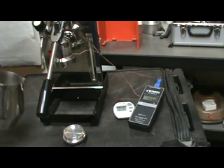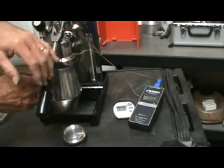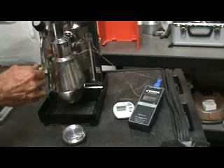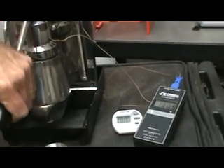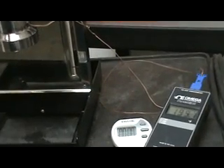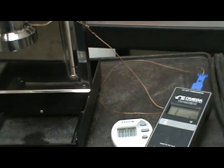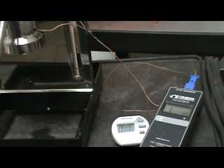So let's just boost this artificially as we start out with our experiment. I'll go ahead and flush the group, and you'll see what happens when the boiler water enters the group. You get an immediate spike in temperature — it's gone off the scale of this particular meter, so that means it's over 200 degrees now. That's the outside temperature of the group, and it will slowly drop back down, eventually below 200 so we can start seeing some reasonable readings again.